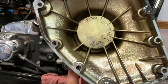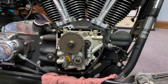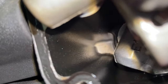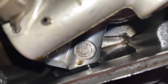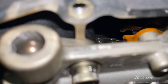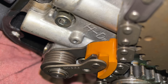First thing before anything, I'm checking for cam tensioner material — nothing else. Not cleaning, not doing anything; I want to see if there's material. This cover is clean. Now I'm looking in the cam chest in the bottom recesses for tensioner material — I'm not seeing any, which is a good sign. If I saw material I'd suspect we came late to the game. The rear tensioner is hard to see but looks to be quite worn.